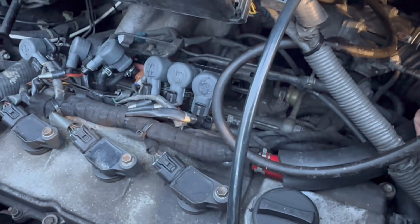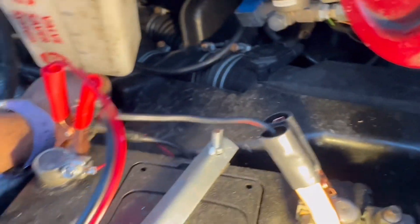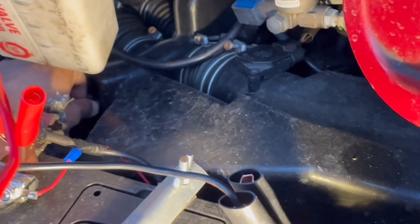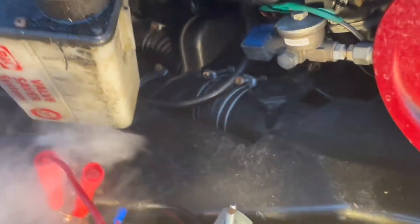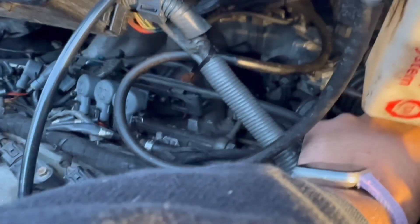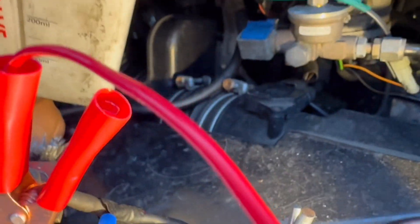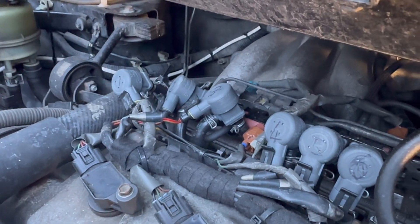You can see it's plugged into the box now, and I'm looking around for smoke. I'm using a torch as well because it helps highlight any smoke and makes it much more obvious, allowing you to look into all the nooks and crannies. There should be no smoke coming out anywhere. But look — when you pull it out you can see the amount of smoke under pressure this thing pushes out. I'm holding it on tightly with my hand, but you can get closer-fitting pipework. No smoke coming out of that area, so I've got a good view all the way around.